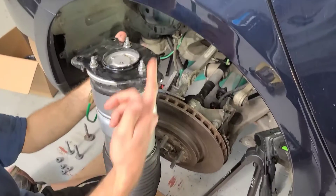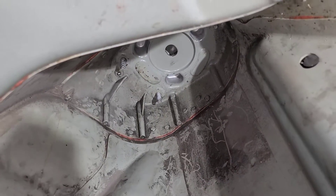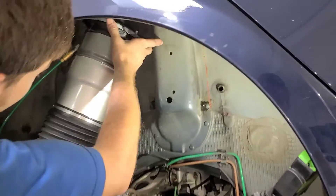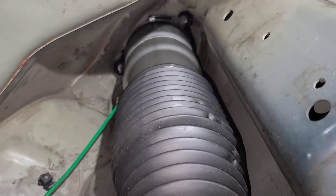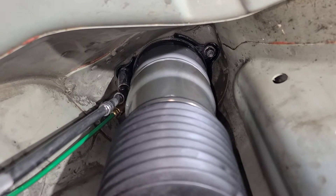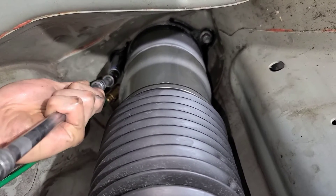Now we're going to put the shock into the car. You'll notice there are three bolts up above — we've anti-seized the ones on the frame, which are all the way up on top. We're going to lift the module into the car, starting in this orientation; you'll come up and into the vehicle. Then we'll take the three bolts and loosely set those into place. I've got a swivel adapter with a deep socket — that allows me to get around to all three of these bolts up at top. We're going to torque these to 40 Newton meters with our torque wrench. This is a 15mm socket.